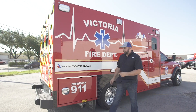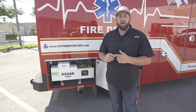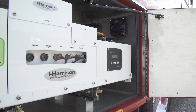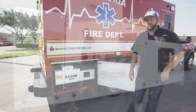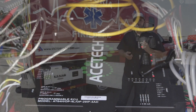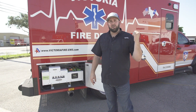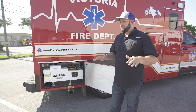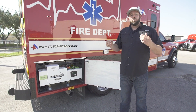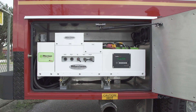I'm super excited to show you guys this new power system. This latest innovation is a Harrison H-Power — it's a high-performance alternator under the hood, powering the entire ambulance body through an inverter lithium-ion battery pack system. The other really cool feature is idle mitigation. We've added an AceTech complement called EcoRun. EcoRun is monitoring both temperature in the module and in the cab, and it's monitoring battery voltage here and of the chassis batteries. Under certain conditions, it will let the truck stay off — those battery packs are actually powering everything on the body, including the air conditioner. And when certain conditions are met, it will auto-restart the truck to ensure that these batteries don't get too low. Really, really cool system — latest innovation from Fraser and Harrison.